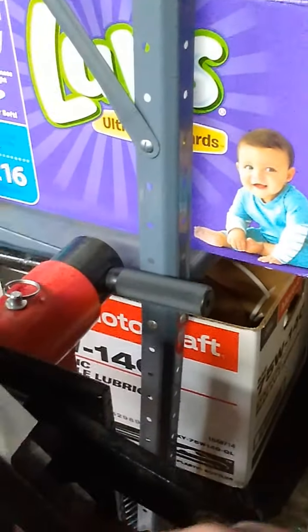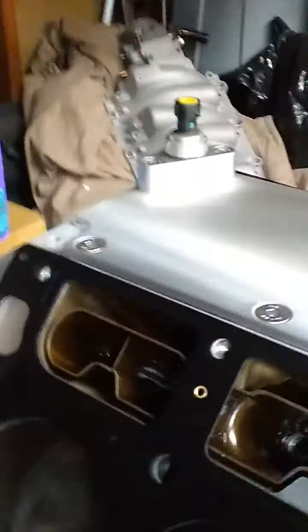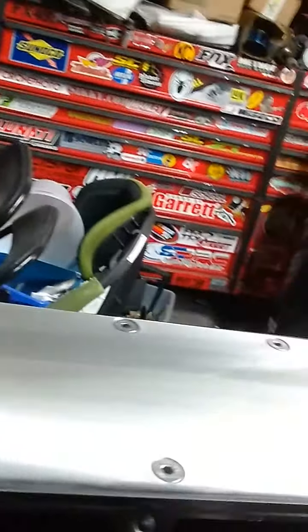So that was one of the things in the back of my mind for this rebuild. Basically, I hope that when I get to the head gasket portion, I don't put them on backwards, because that would suck. That's what I was just noticing on that other one, and I'm glad I noticed, because there's a water passage right here, and you know, here on the back. I actually just had this gasket on backwards, you mostly saw it on camera. These were over here, and I thought that looked weird, and now we know why. So good catch, appreciate it, guys.